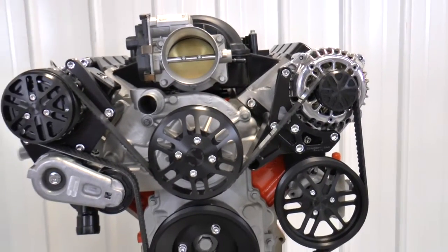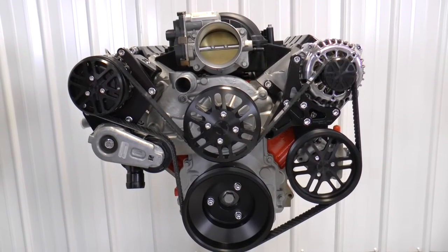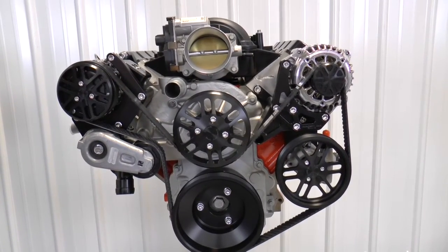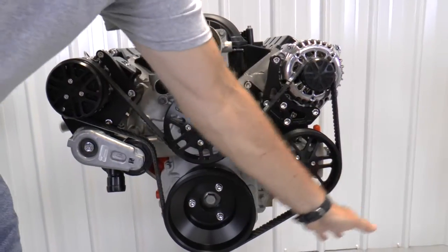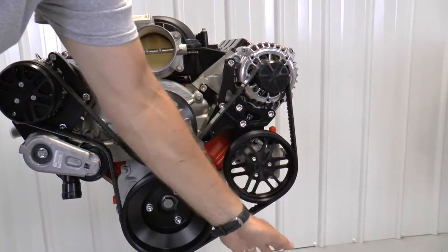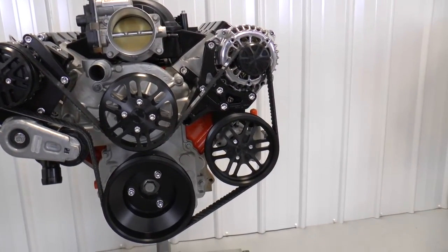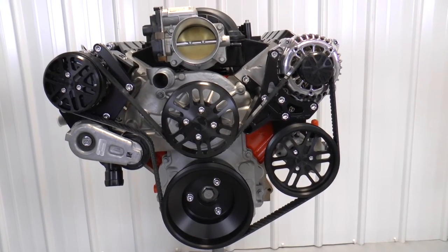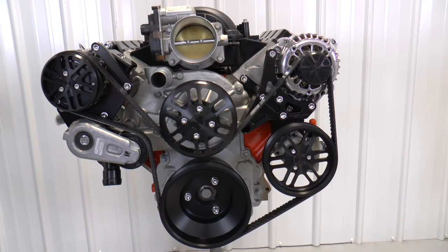Also, this kit — because of the diameter of the pulleys — the diameter had to be bigger for the supercharged kit, and we went ahead and used the same pulleys. But the diameter of these pulleys are larger, and because of that, for clearance issues with steering gears, rack and pinions, and steering shafts, this kit will come standard with a remote power steering reservoir for standard steering, or we can do it with hydroboost. There's no extra charge for that.